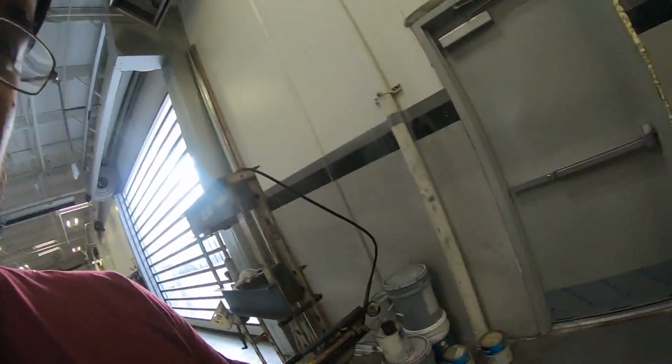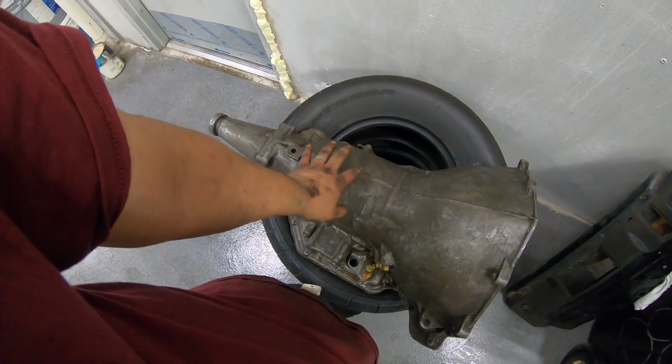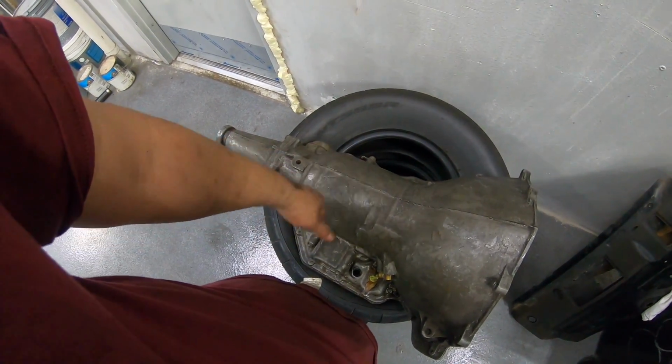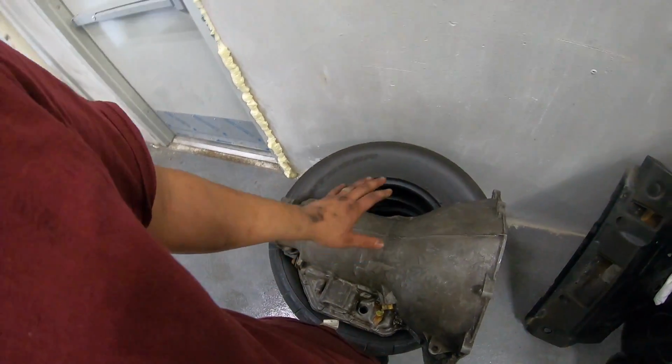Yeah, while he is using the LS3 and TR6060, I'm over here with the old school LS1 and the Turbo 350 trans out of like a probably 70 something pickup truck or something. This is what I picked up, and it was $100. I'm gonna go through it and rebuild it, put in a manual valve body, upgrade whatever I can upgrade, and I'm sure it'll be plenty for what I want to do. The guy said this could hold like 400 to 450 all day on a stock rebuild, so that should be fun.